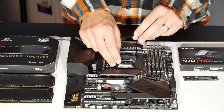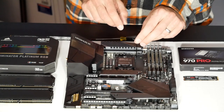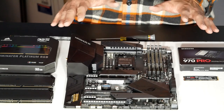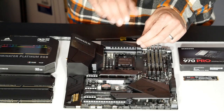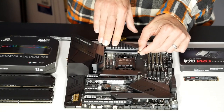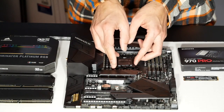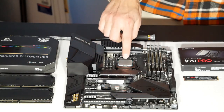The next step is to lower the lid underneath the locking bolt — you do not actually need a screwdriver to undo that. Now I'm going to lock the CPU down. For a lot of people this is the most stressful part of building a PC, because you feel so much tension on this lock, you think you must be crushing your CPU — but you're not. The plastic lid will eventually pop off as I lower the locking bar, then I lock the bar underneath the catch and remove it. My CPU is installed.